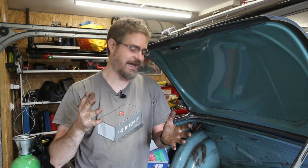There's not really anywhere that I can manipulate the exhaust to that's not going to massively reduce flow or add in lots of horrible bends, and I really don't want that, because the exhausts flow really nicely, and I think that's why the car performs so well when it's tuned right. And unlike a Legnum, which has a 2.5-inch exhaust for the whole thing with all 6 cylinders, this has got a 2.25-inch exhaust per bank per 3 cylinders, and I think that really helps those tiny little turbos at the top end, so I do not want to mess with that.